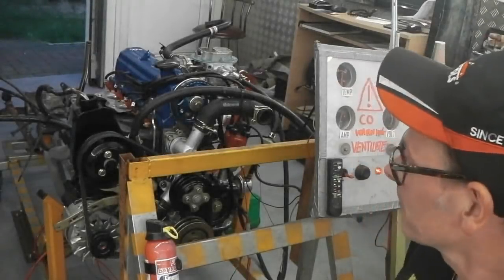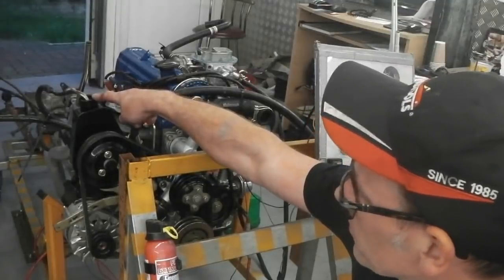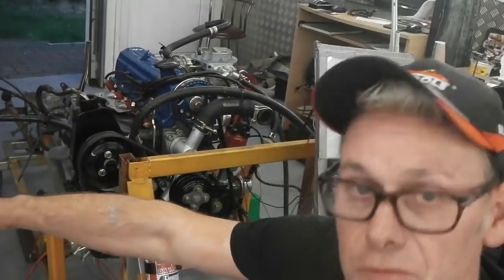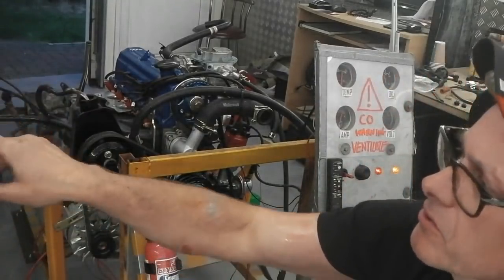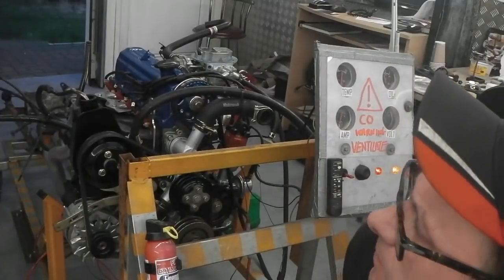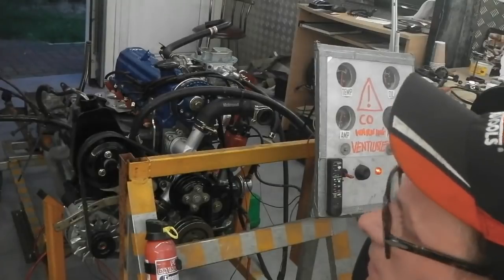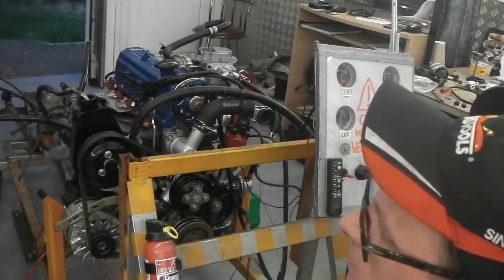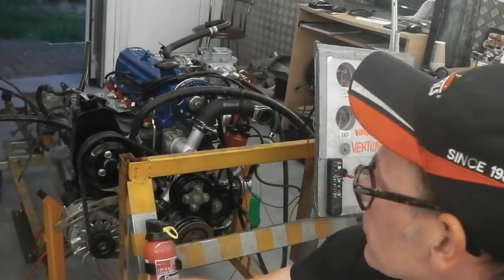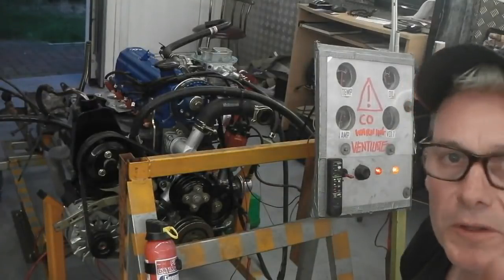Okay, so let's have a summary. On the safe side, the high pressure output of the pump, we've got it going back into the reservoir because I noticed it trying to pull off on one of the hoses, so we're not quite sure which is the input and output of the power steering rack. We don't want to risk anything there. We need to further investigate that situation and get some correct fittings. These on high pressure aren't going to do it, so we've had a pipe start to spray out. We don't want any of that.